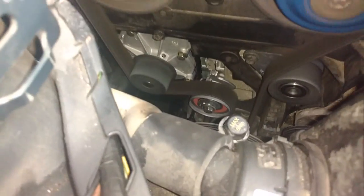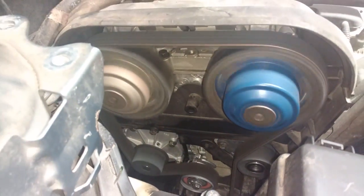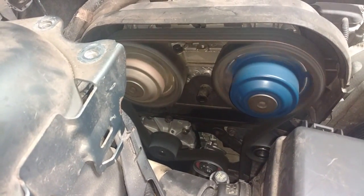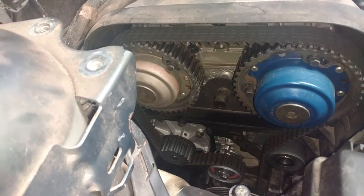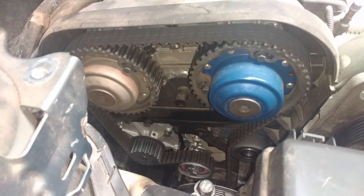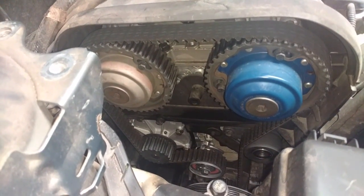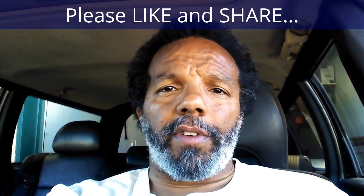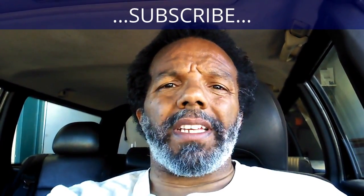I fired it up to make sure everything is rolling smooth and tracking right. Since there's no cooling yet you don't want to run it long — just long enough to make sure the timing belt and everything is tracking. Shut it down and finish the install. From here you want to top up your coolant, put your serpentine belt on, start the car, check it for leaks, top your coolant off, then put your cover on, put your engine mount brace back on, and you're all done. If you found this information useful, please like it and share it. Subscribe to my channel for notifications of future videos. You can follow me on Twitter, and if you need to contact me directly please visit my website. If you have any questions, leave them below and someone or myself will reply. Thank you very much for watching.